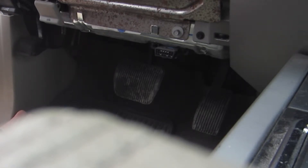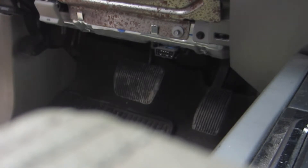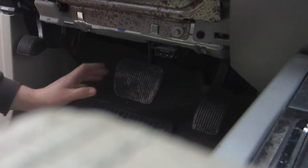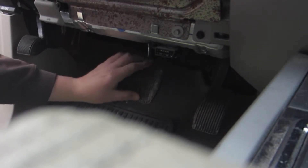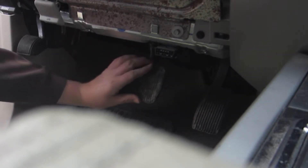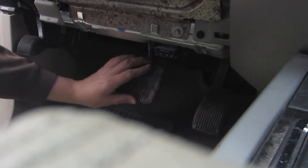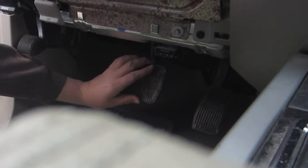Press the override button once, and it will click five times — or the horn will honk five times — when you're in the right mode. After that, we need to get to option seven. Press the brake pedal seven times, and you can hear the thing clicking or the horn honking.